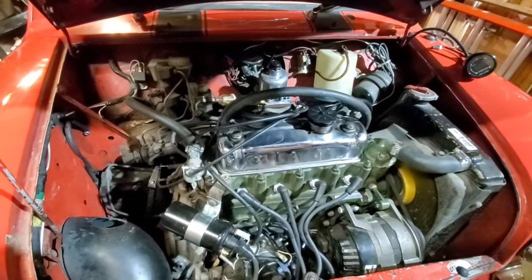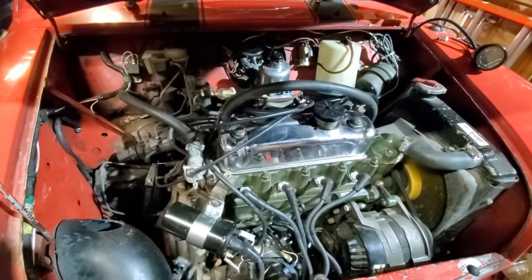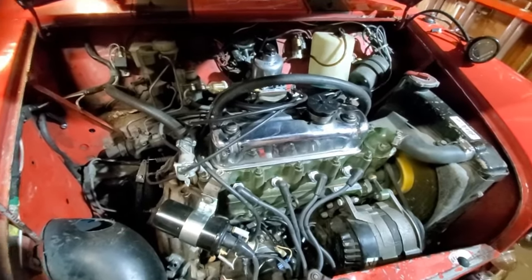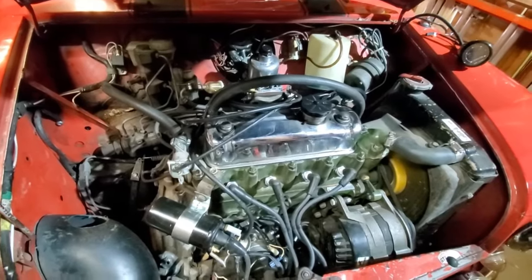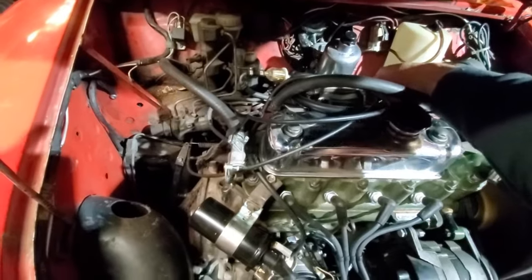I switched from the AEM needle that I put in there to an AAC, and then modified for 3 to 5,000 RPMs. I also ended up switching dash pot oil from the ATF down to a 530, but I think it sounds pretty good now.